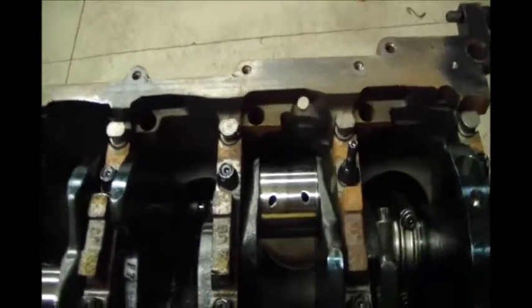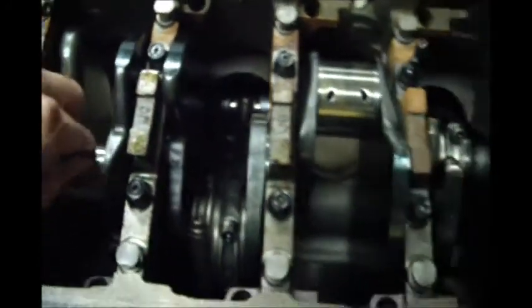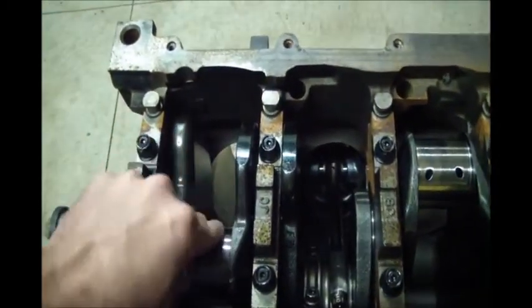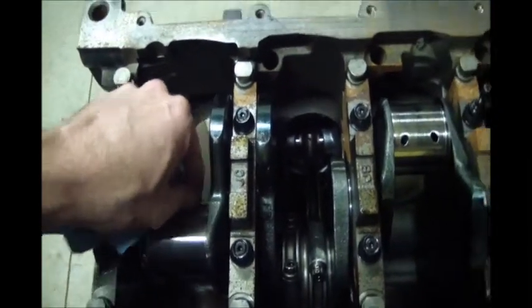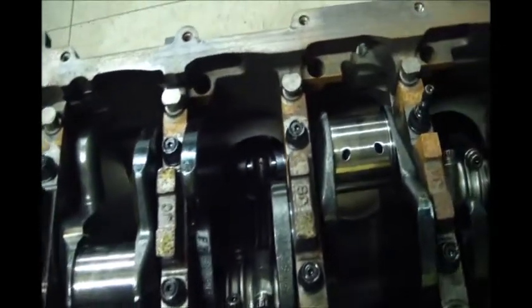So, I mean, just hitting it with a paper towel has gotten most of it. I do feel you can sort of see a little bit of raised spots there. The bearings definitely wouldn't like anything raised. A depression won't really hurt a bearing. It'll actually be a spot that'll hold oil, so it's not the end of the world if you've got some slight pitting. Main key is take down any sort of raised protrusion that will wreak havoc on a bearing.